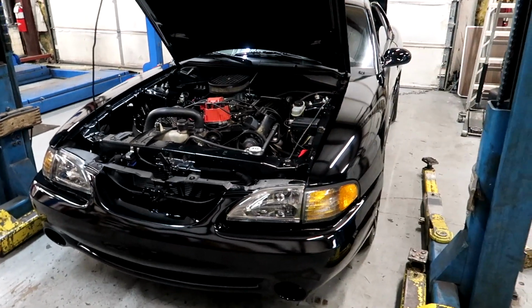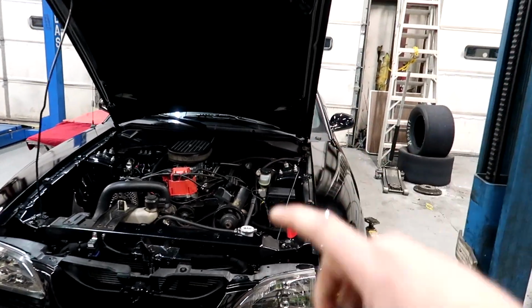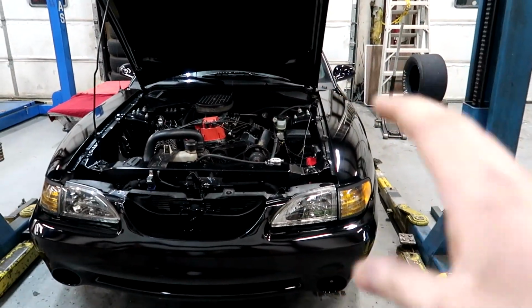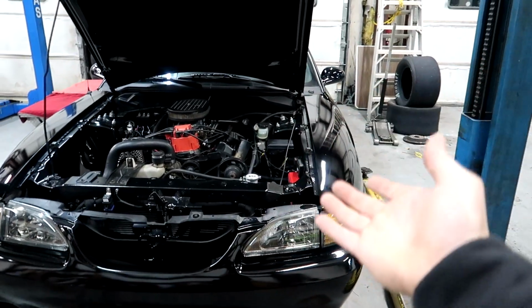Can nitrous be dependable? And I do think that nitrous can be dependable, but the best way to keep it dependable is to stay on top of it. And what I mean by that, whenever you are running nitrous or making nitrous hits, you constantly need to be checking your plugs, double checking your AFRs, making sure everything looks right, checking your timing marks on the plugs, and also reading your plugs to see if they're rich or lean.